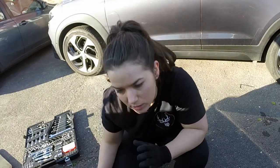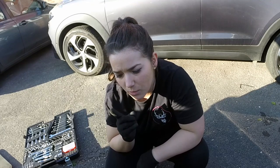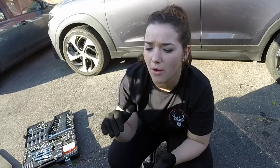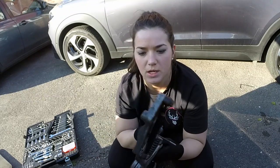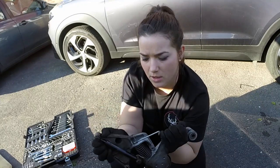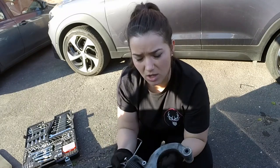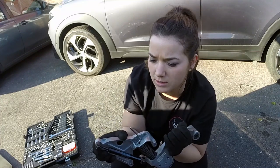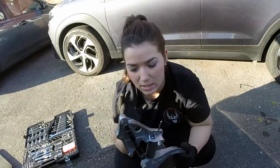So now we have the old tensioner off. One of the main reasons I wanted to change the tensioner was because when I fitted a new idler pulley and took it for a test drive with a new belt, the car started up fine, but when I was in third gear and did a quick pull, the belt just totally slipped — so there was no boost. That's why I thought maybe the tensioner was failing. This is the old tensioner — and as you can see, there is absolutely no tension in that at all. It's really, really easy to move. So I can only assume that when I put my foot down, the belt just slipped because there's no tension. And this is the difference with the new one — that is a lot more difficult to move. So I'm hoping the new tensioner is going to fix my problem.